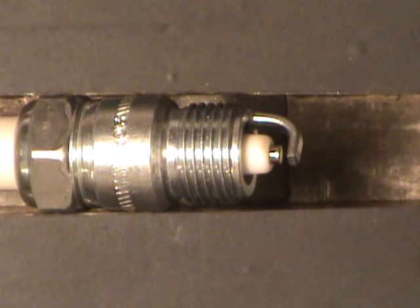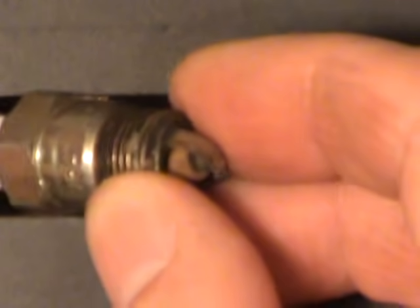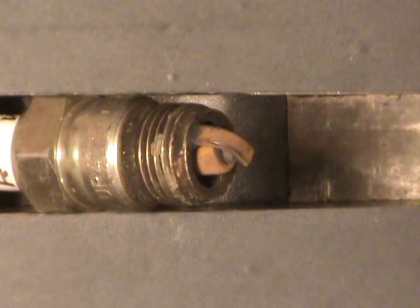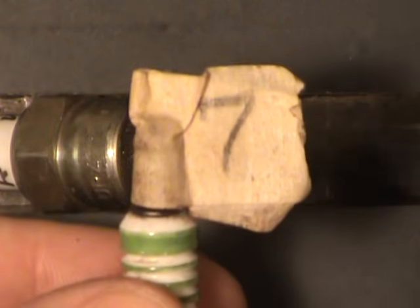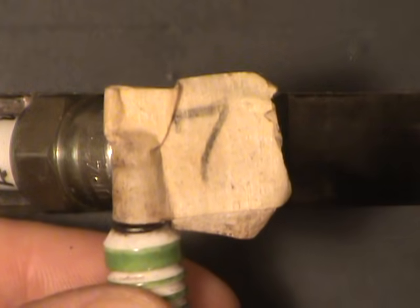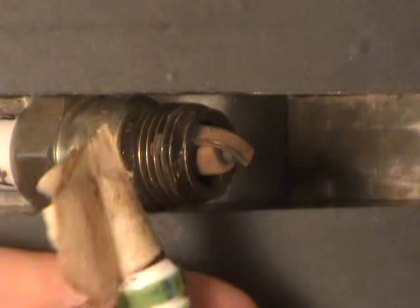Let's start with one that would indicate a good burning engine, especially when it comes to carburetion. Here's a really good example of what I like to see when I'm doing plug changes. What I do is when I take plugs out, I usually get a piece of masking tape and mark which numbered cylinder it comes out of, that way I can go back later and identify — if I've saved one plug out of the set that has a problem, I know which cylinder has given me the headache.